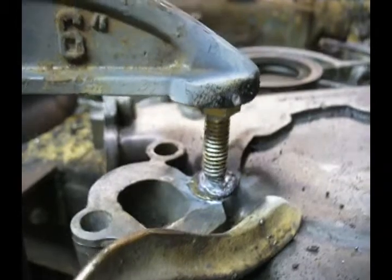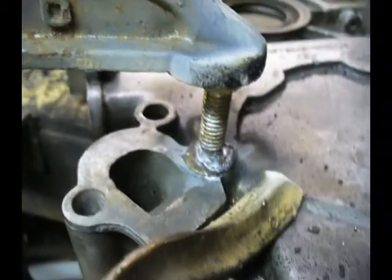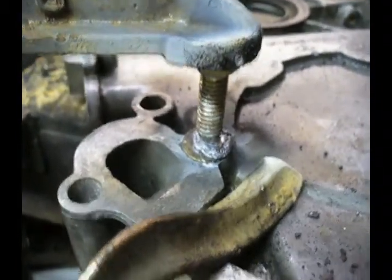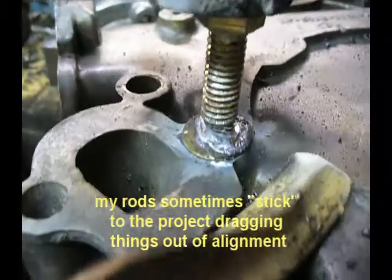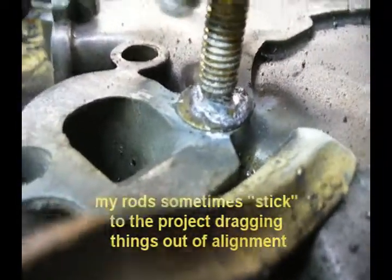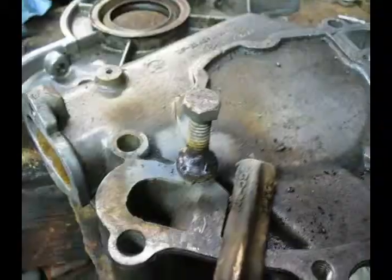Here's the setup. I decided to use a 3/8 bolt. We got it clamped down on top of the project with the ground welder strap sitting close by. The whole thing about welding is getting your jig so that nothing moves when you hit it with the stick. So we'll weld that bolt right to the washer that I ground off. I ground off the weld a little flat so I can get that bolt to stand up straight.